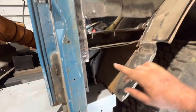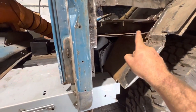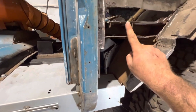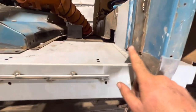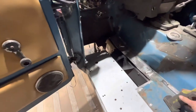I'm going to do the repair panel in two pieces - make two little lips, one for this one and one for this one, probably tack weld those together to give an extra bit of rigidity, then make a panel here and a closing panel here. We've also got a small panel to make here and a small panel that goes here. That's obviously now revealed more rust to deal with at the back - we were expecting that. Next thing you'll see is a time lapse of this all being welded together.